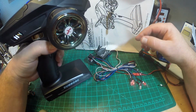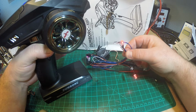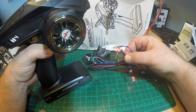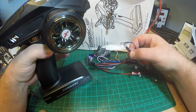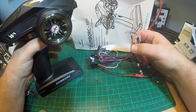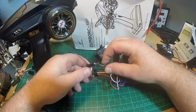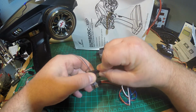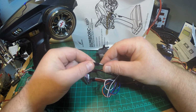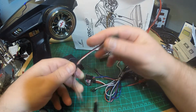And also these kinds of brake lights, these are red lights, so it's reverse lights. You should probably make them white, or if you want those, maybe install additional red LEDs as normal lights, but this won't work either, because you can't plug red and white LEDs in parallel. So I can show you this also now.